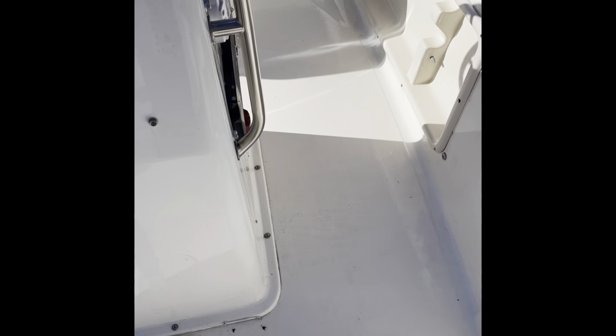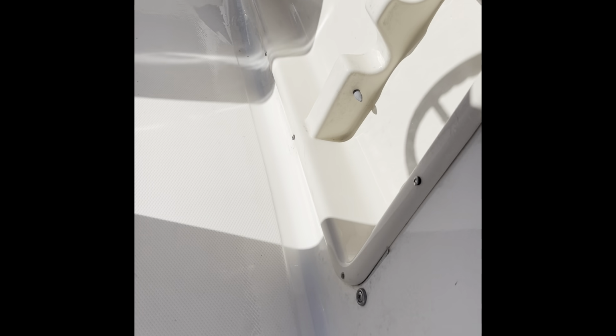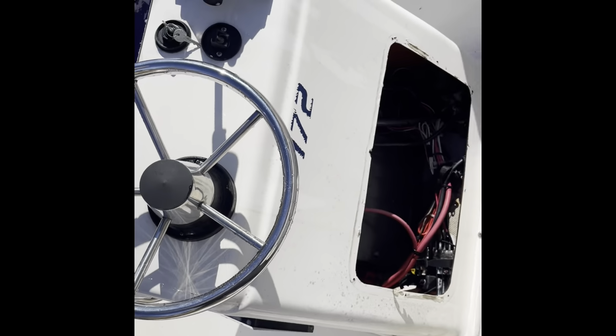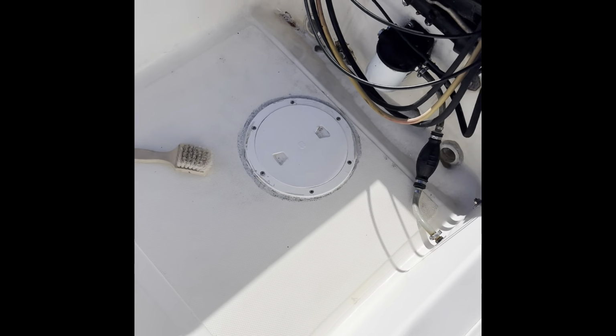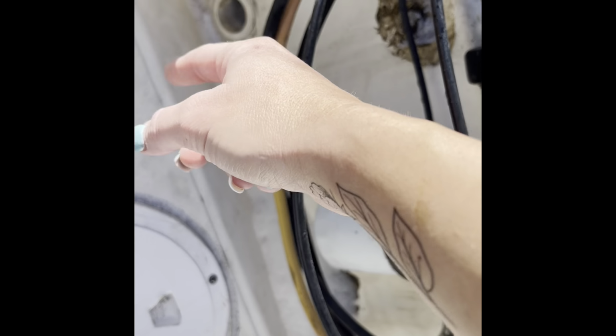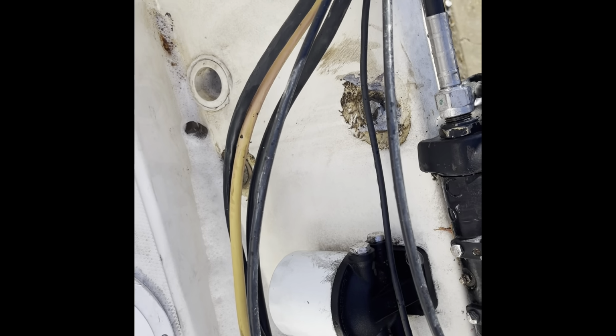Okay, we got most of that mold off the surface. If you look in some areas, I couldn't get it all the way, like I said before, but it's a lot better and it's gonna save a lot more time wet sanding. All that mold's not gonna come up and clog the paper. Went ahead and cleaned all in there. I'm gonna have to come back here with some kind of degreaser. That Purple Power is not strong enough to get the grease off back here, but I'm gonna have to start wet sanding the outside and move to the inside.